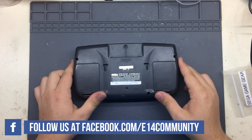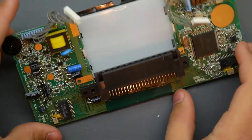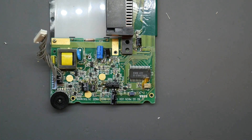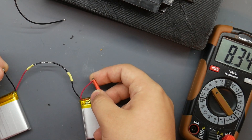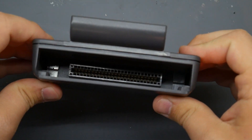The system only used six AA batteries, which only led to a few hours of gameplay. To combat this, I'm going to replace the fluorescent tube and the high voltage components with LEDs to increase efficiency and battery life. I'm also going to implement lithium polymer batteries to make the system rechargeable. Lastly, I'm going to 3D print a new case to make the system thinner and allow me to permanently attach the Master Gear accessory, making the system able to play both Master System and Game Gear games.